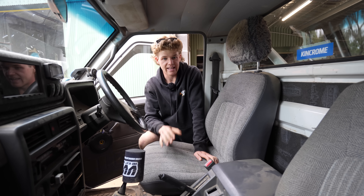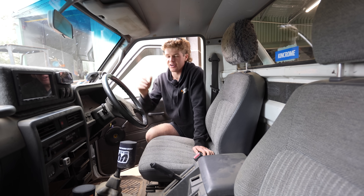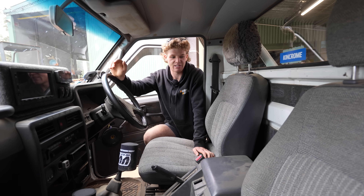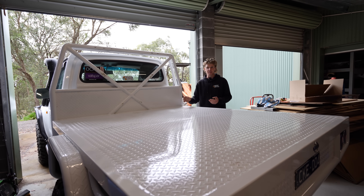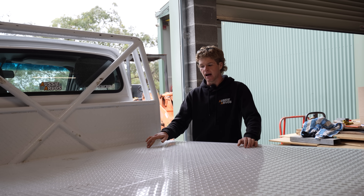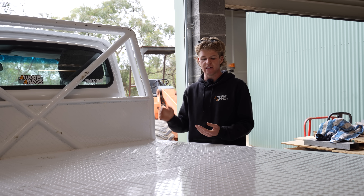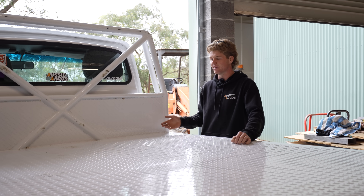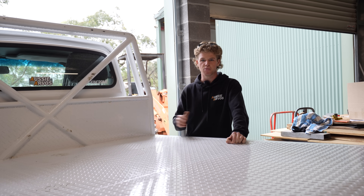The next spot I considered was mounting it in the cab. A lot of people with single cabs or dual cabs will mount their battery behind the seat on the rear wall, but unfortunately in the old GQ space isn't really a luxury, and even looking at some of the thinnest batteries on the market, it just wasn't going to fit behind the seats. The next obvious option is to stick the second battery system in your canopy. I will be getting a canopy very soon, but I want to be able to lift the canopy on and off, and I didn't want that to limit whether I had a 12 volt system in the car. I want it fixed on the car permanently so I can lose the canopy and still strap a fridge on the tray.